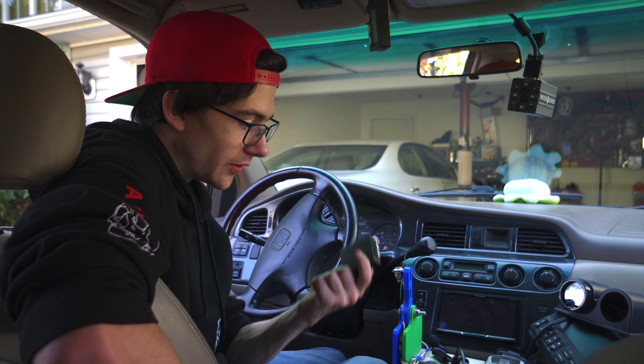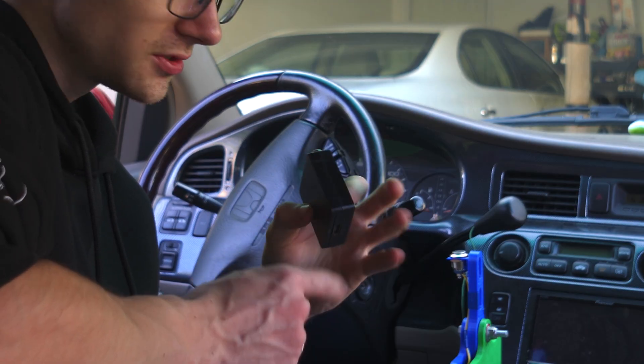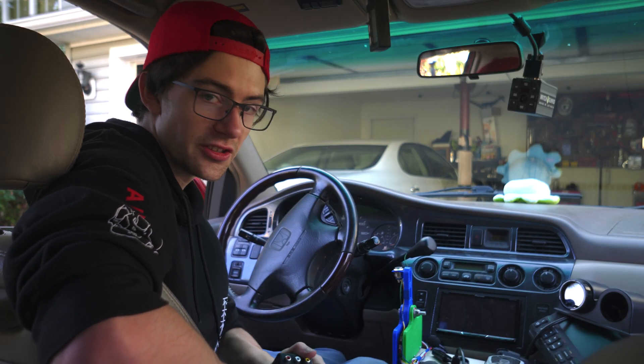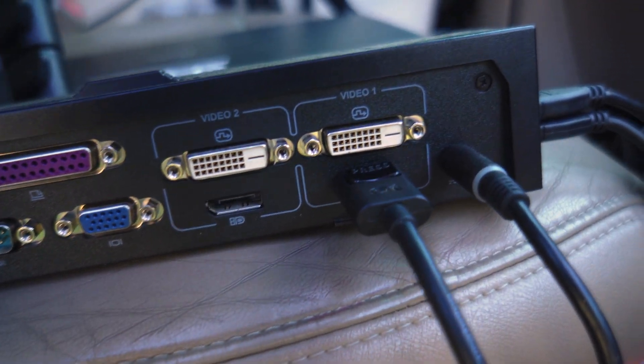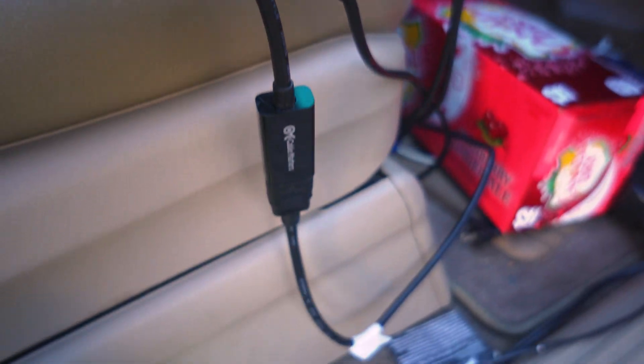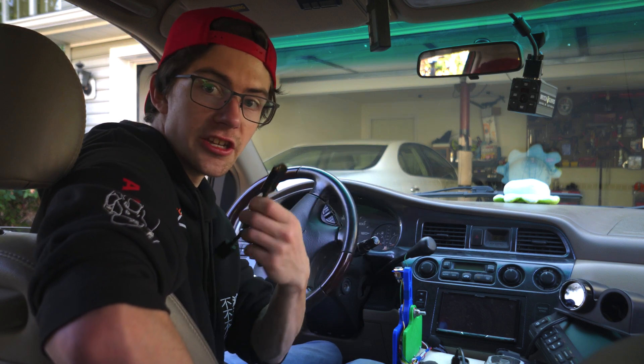In order to do it, I've got this little adapter box right here. It's going to take an HDMI signal and convert it into RCA, which I can funnel into the head unit. On top of that, just because the laptop I've got only outputs DisplayPort, DVI, and VGA, I also have a DisplayPort to HDMI adapter.